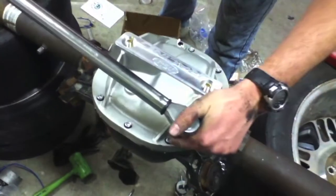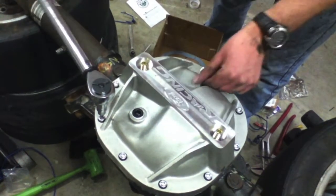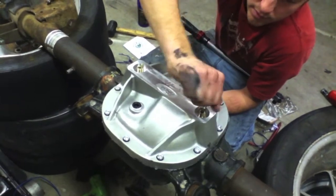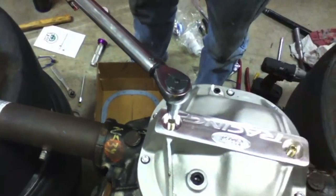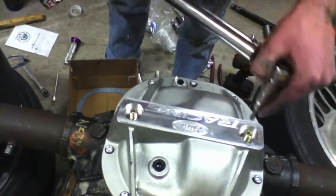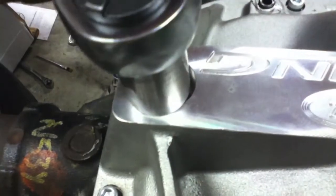Something very important to remember if you have this kind of girdle on your rear end: these are the load bolts. What these will do is you tighten them down until they barely touch the main caps — the bearing caps. You do not want to put too much pressure on these as it can cause damage. So you want to just tighten these down until they barely touch, then torque them to five foot-pounds. Remember, these bolts are now helping push on those main caps. Do them evenly. With these ones at five foot-pounds, there are also jam nuts that go around them, and we're going to tighten those to twenty foot-pounds.